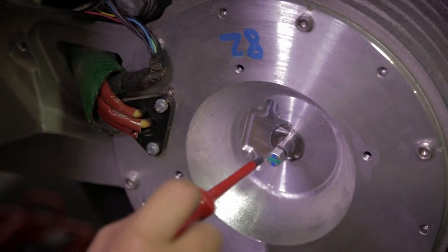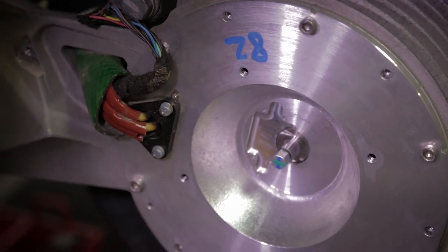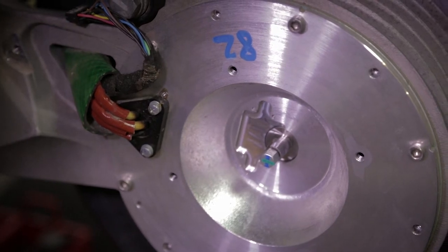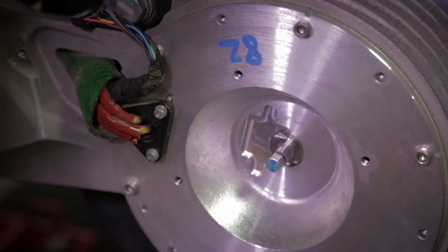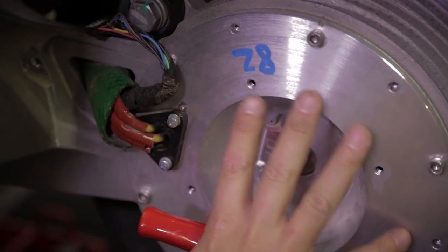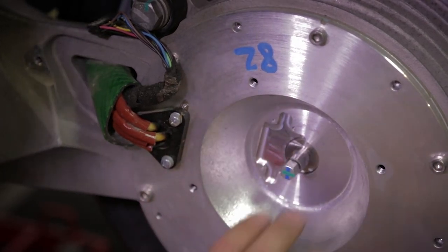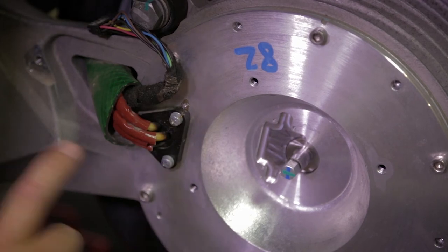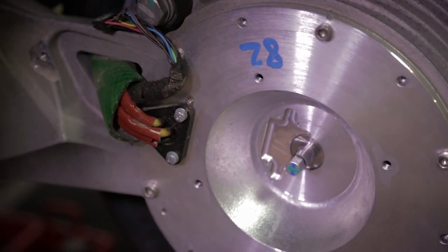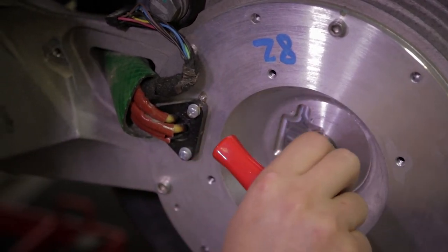A dirty encoder can also result in overheating. If the signal coming back to the motor controller is detected as corrupted, we will have an error message on the display showing 'encoder.' The bike will continue to drive with limited performance. In most cases, it's possible to dismount the encoder, clean it carefully, mount it back with a new gasket, and recalibrate. We will see later using the diagnostic application how to calibrate the encoder. In some other cases, it will be required to replace the entire encoder.